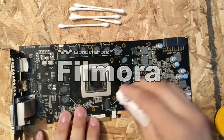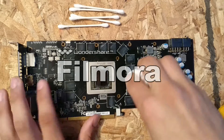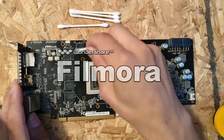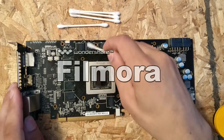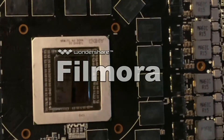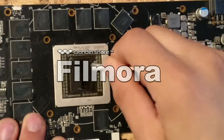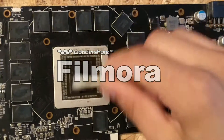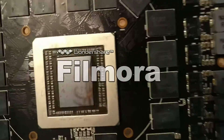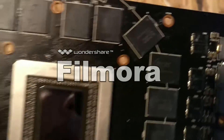Next is cleaning the graphics card. You're going to want to get all that thermal paste off — in my case I had to remove a lot more than you will. I went over it with a facial tissue, and now I'm using Q-tips and a bit of rubbing alcohol to get the rest off. You want to make sure you get all the thermal paste, including what excreted out from the GPU between the transistors. And as you can see, it's now nice and clean.